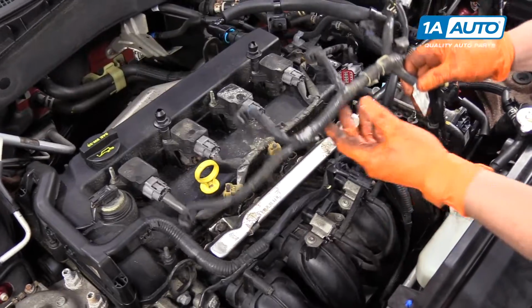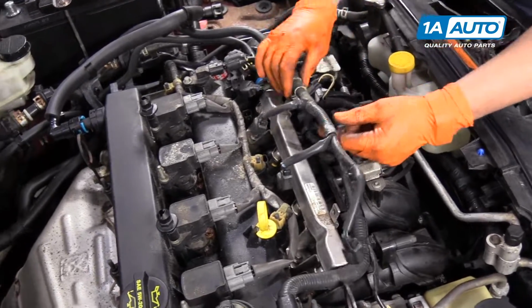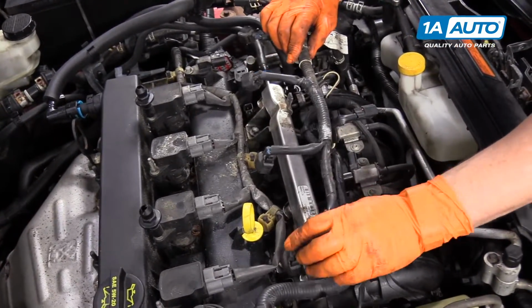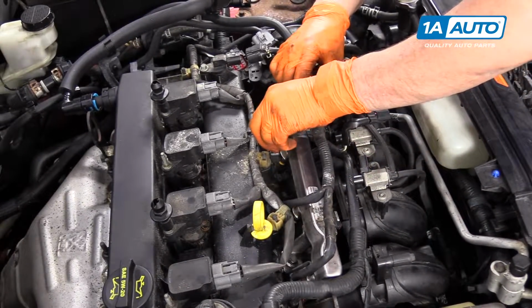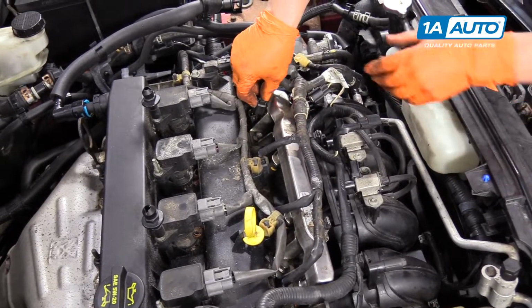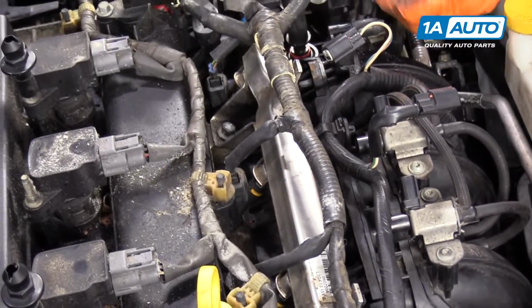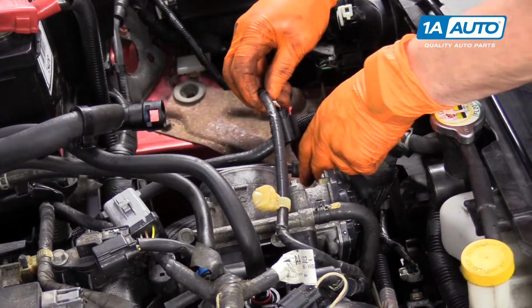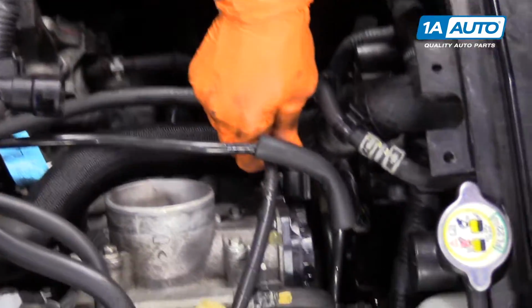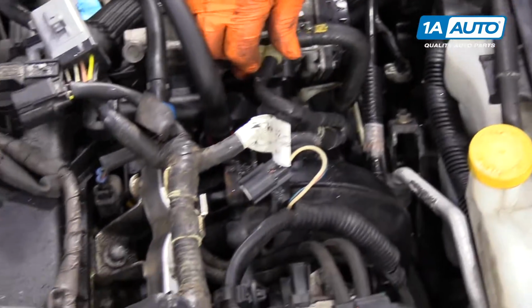Okay. So because the vehicle is an 07, the harness is pretty well fitted to the way it used to be. So I'm going to connect cylinder 1, 2, 3, and then 4. I'm going to put the plastic eyelets in where they were located. Now this is the electronic throttle body connector. That clicks down, and push that red tab down. That's a locker. And that went on that bolt for guidance.